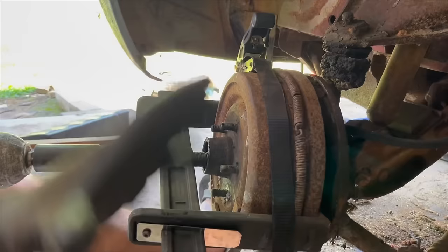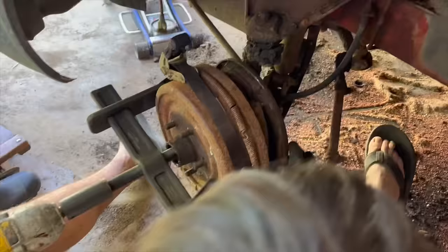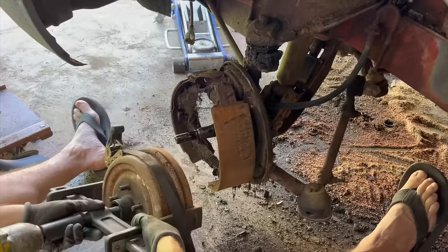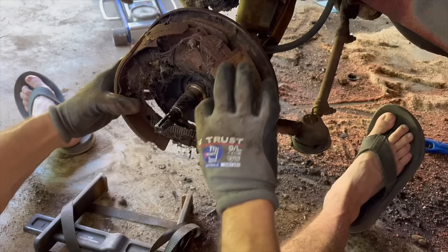Up that way, something at the top's holding it. There we go. It's probably bending something. Losing stuff from the top. Oh, geez. Looks like our brakes are adjusted way out. Our springs are still there, but of course our hold downs, which are also springs, broke. I don't have new ones. Well, the drum doesn't feel all grooved up and messed up. It looks like Tales from the Crypt again in here. Yeah, it looks like we're definitely going to have to do something with the hold downs.